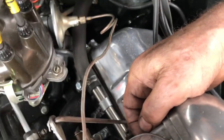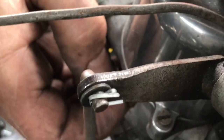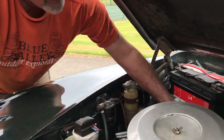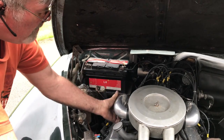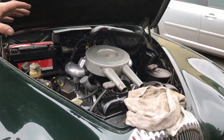And what it should do — come over the side, it's very useful to see. That's the little button here. You can hear it going up again so it's still too rich. And this is the mixture screw just here. This lever right down the bottom is the adjusting of the mixture. Now when I raise it now, it starts to falter. Yeah, that's just dead right. Just raised up a little bit so I'll just put a little bit on that. Now it's just dead right — it's hushing. It's still around 650 RPM but it's now smoother.